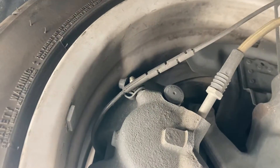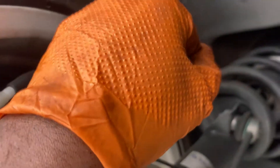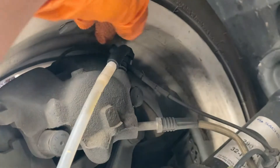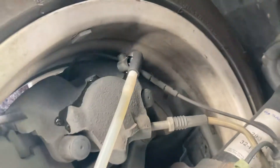Let me show you this one since it is a front wheel. Same procedure: take your little cover off, move the brake sensor line out of the way, and there's our nipple. Take our suction hose and place it over the nipple, and there goes our brake fluid — easy peasy, except for that... yep, this is my fault.